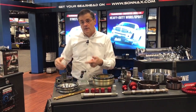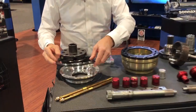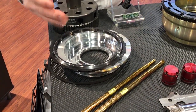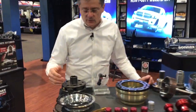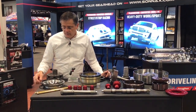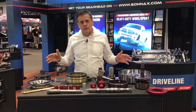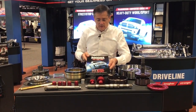And then if you do want to add capacity to the K2 clutch, we have a billet piston and backing plate system with a selective snap ring for setting clearances. If you drop this kit in, then when you're building the unit, like many of the other kits we have, you can add one additional clutch plate and steel and still be able to adjust your clearance. So that's a great group of new Chrysler parts we have, but I also want to mention the HD Work Sport catalog